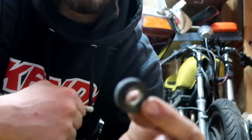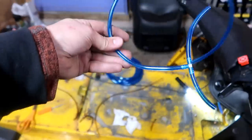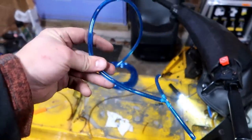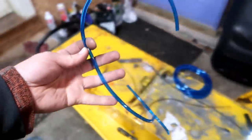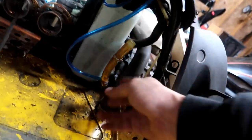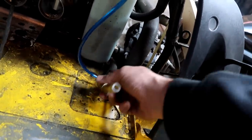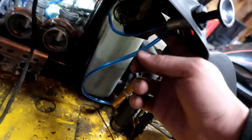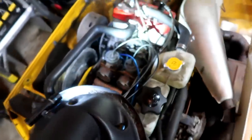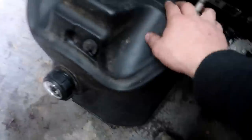There's our old nasty grommet — that's how that works. I just finished replacing the lines that go from the primer to each carb. All the other lines I checked look good, so hopefully this fixes our issue. Just to give a rundown of everything we did: I replaced the T between these two lines, the main fuel line, the two primer lines — one up to the primer and one down to the carburetors — the line that goes in the tank, and the grommet at the end of the tank.